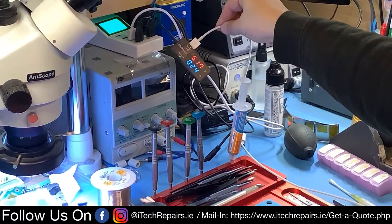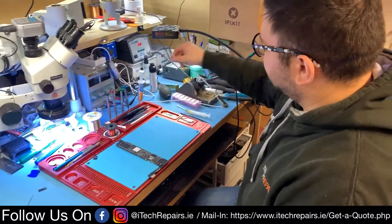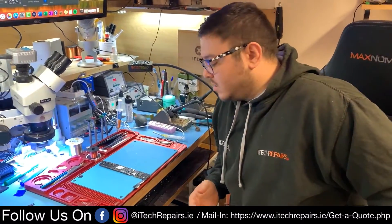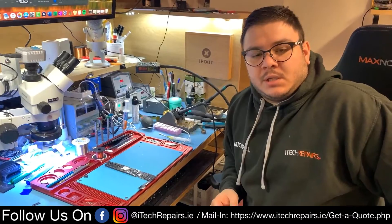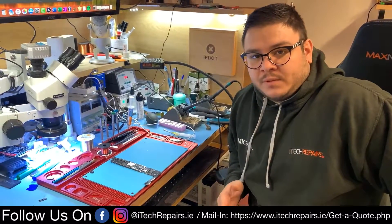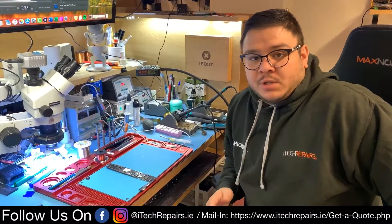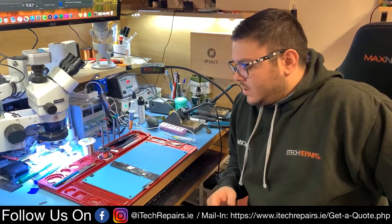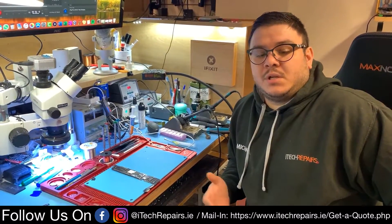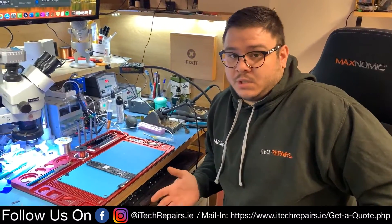My suspicions were true in terms of the problem itself. Based on what the customer told us and previous experience with other iPads and iPhones, we came to the conclusion that the problem was the charging IC. We don't like to use fancy Tristar testers — we've seen them fail a couple of times. Boards sent to us previously tested with that equipment: sometimes if the charging port is faulty the Tristar cannot be tested, or we've had situations where somebody replaced the charging port and kept trying to test with Tristar testers — it was failing over and over, and they assumed it was the Tristar when in fact it was just the charging port.